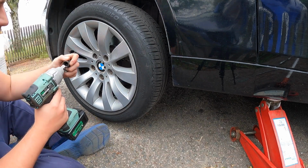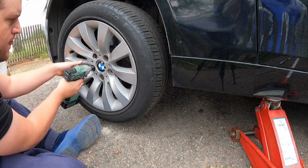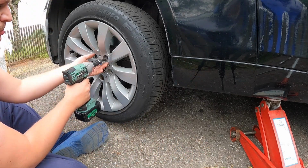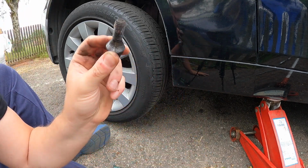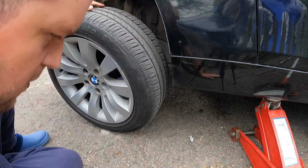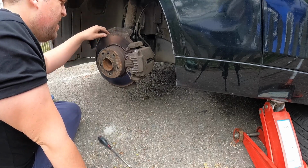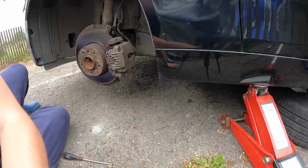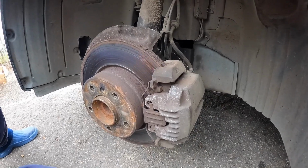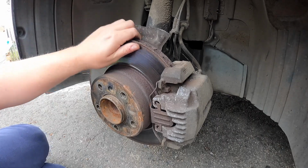Right, get the wheel off because I'm lazy. Gun. Right, put them somewhere where I'll probably lose them. Awesome, and they've even got copper grease on there. That's nice. Right, gonna pop this onto the car. Safety first. Right, have a quick check. Pads have got meat on them actually, to be honest with you. But this disc has seen better days, so still glad I'm doing it.